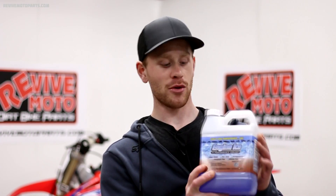There's a variety of reasons why you need to be changing out your coolant. The first being just wear and tear — I'd say 40 or 50 hours is a pretty good number to change out your coolant. And if you're going to a higher quality coolant, I'd recommend using Engine Ice. This is the same stuff I've been using for years now, and I've had really good luck with it.